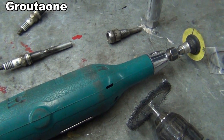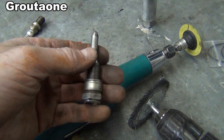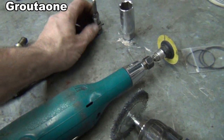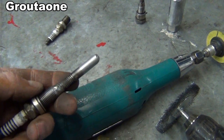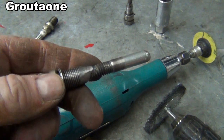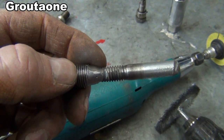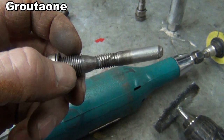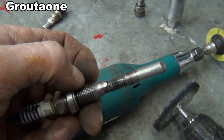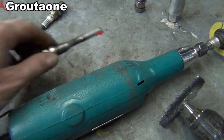I need a piston stop tool for today's video. Years ago I made this one, but it's too short for today's project - I must have made it for a small block Chevy. So I made up another one today with a bolt I cut the head off and rounded off, but the problem is I kind of welded myself up into the thread of the spark plug, and that head has aluminum threads - I really don't want to bugger that up. I don't have a die to clean this up, so with a combination of both tools I've got it working pretty well.